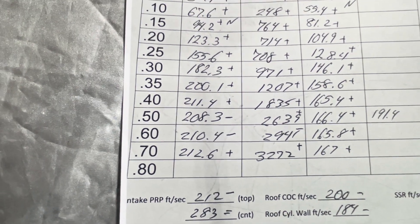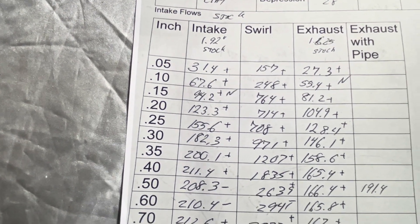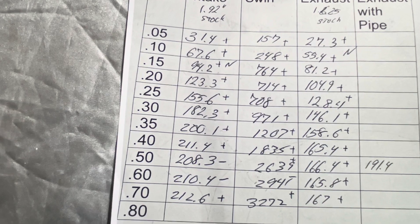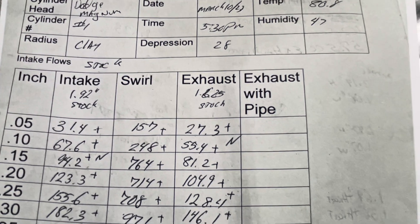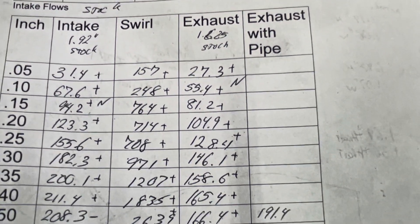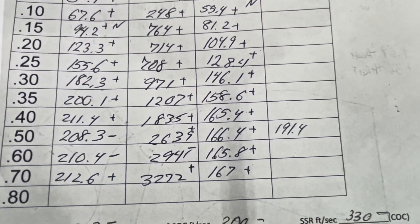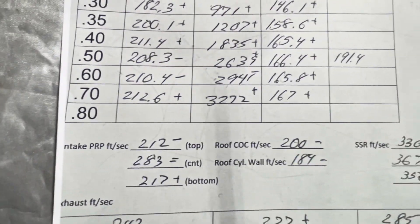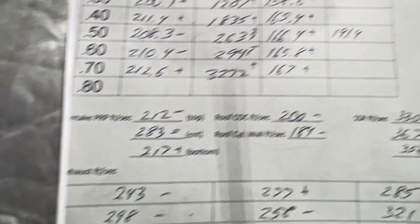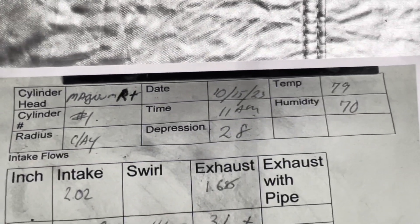There's another 2 CFM gain — it's almost nothing. So as long as you get it up around that 400 to 500 area and hang that valve open for a little while, you'll do okay. A lot of old-time cams are like that. Here are the exhaust numbers and the swirl numbers — not sure if you're into swirl numbers, some is good, too much is bad. Here are the airspeeds that Charlie reported for me.